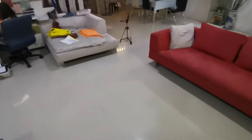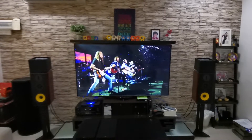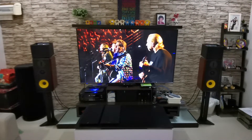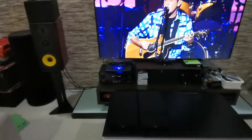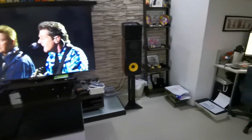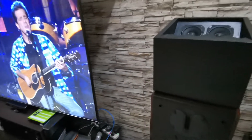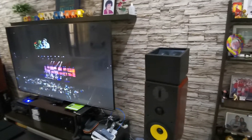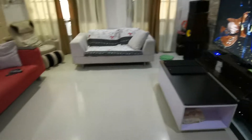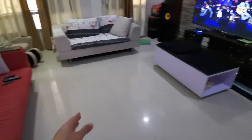Initially I tried this Dolby Atmos setup and I was quite disappointed because I did not get a very clear, pronounced effect of the sound bouncing off the ceiling. But this morning I was playing the Eagles concert and the Denon AVR had automatically set itself to DTS Neural X, which fires off the Atmos speakers all the time. That gave me a chance to calibrate the Dolby Atmos speakers. I stood around and got a good effect, but as I moved back to my seat I noticed the effect fading, and I realized the angles were probably not right.